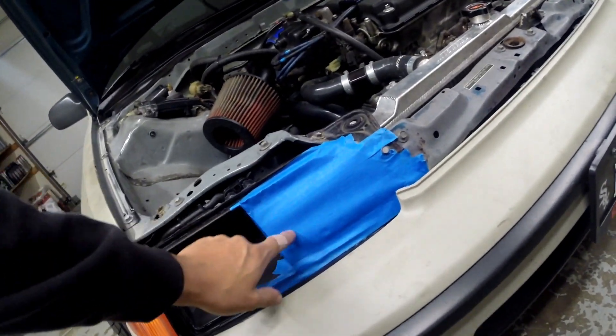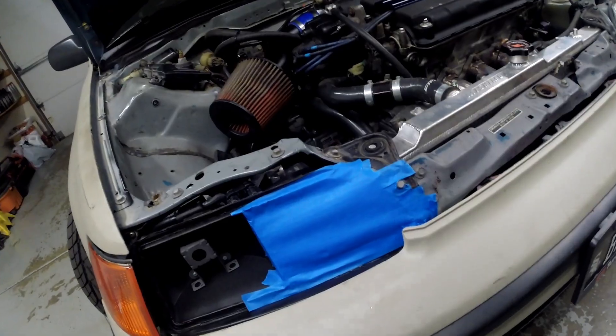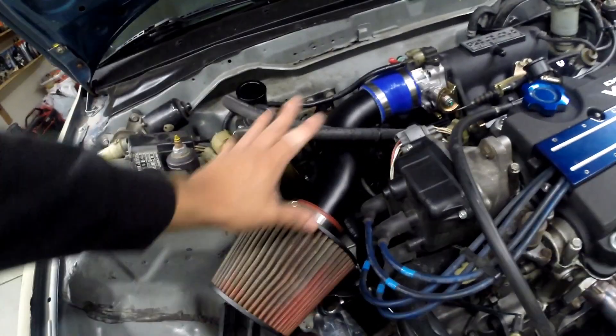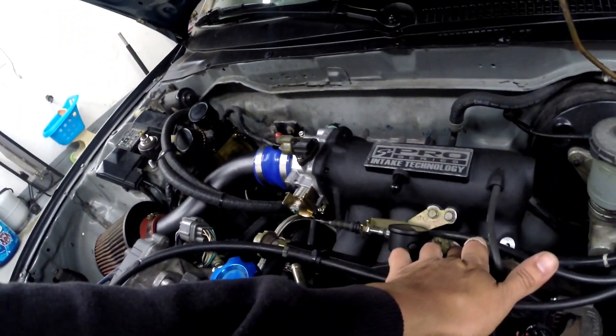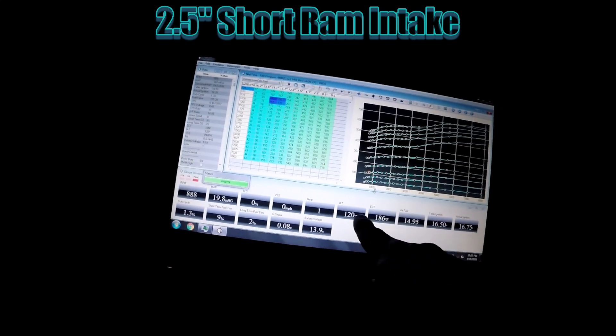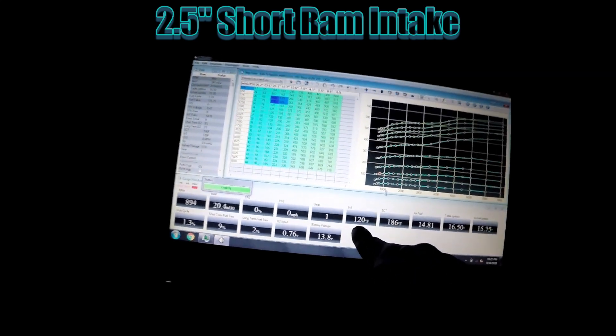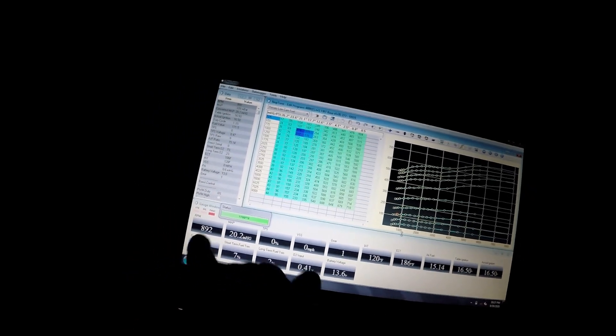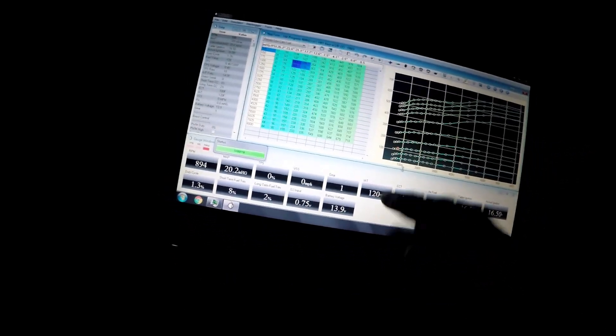I've pretty much blocked out the three inch hole that I had made for the velocity stack so no airflow is going in there, just to simulate stock air filter settings or a short ram intake setting. Let me see what the intake air temperatures are for this one - a two and a half inch with a short ram intake and a filter. This is all done with the stock location. The intake air temperature at idle with the two and a half inch short ram intake with a filter - it's already at operating temperature - is 120 degrees Fahrenheit. We'll go cruise around at a steady speed and see how much it drops.